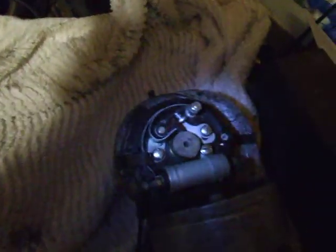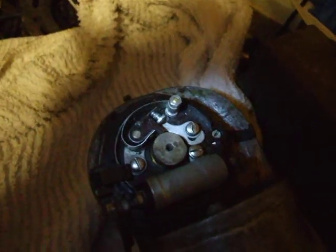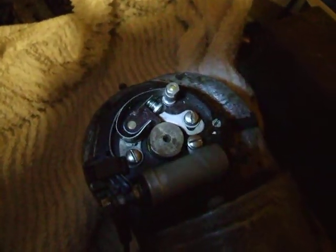Are we saying that the dynamo actually powered it? It can't be. Anyway, it's a Lucas regulator, an RB108, and the dynamo is a Lucas C39PR. Unfortunately it's had so much corrosion on the body it was a bit hard to read whether it was 12 volt. I'll turn the dynamo over and you'll see a contact breaker.